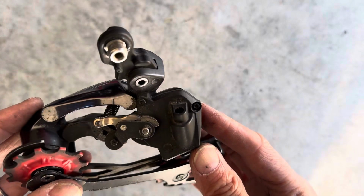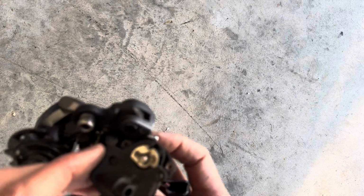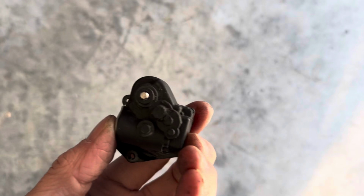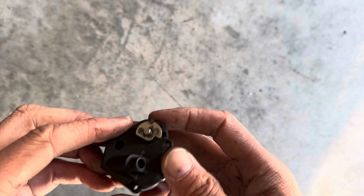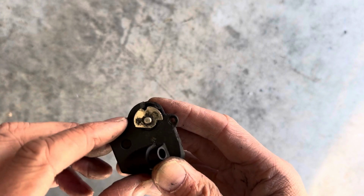with a slotted screwdriver. So again, this is the working derailleur. You can see there's a screw here, there's a circlip here, and 2 more tri-wing screws. I cut slots in the screw heads and took the motor off. It's more than just a motor, but you can see here's where the E-tube plugs in. Here's the thing that turns and moves the cage.